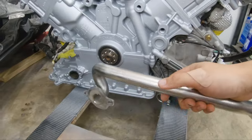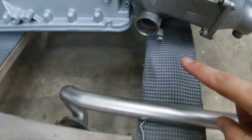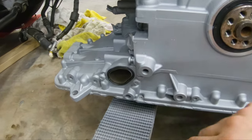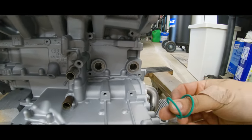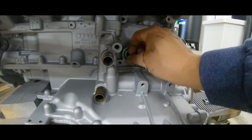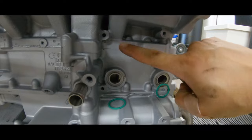This is the coolant crossover pipe. There are two O-rings needed — a kind of oval egg-shaped O-ring that goes here, and another O-ring that goes right here. I'm going to lubricate this one with grease so it can get nice and snug — I don't want to insert it dry. There's no need to put silicone grease on the other one. Two screws hold this side and there's one screw on the other. Next, I'm going to install the oil cooler, which needs two O-rings and four same-size bolts.